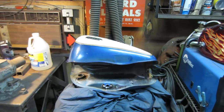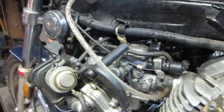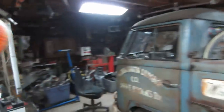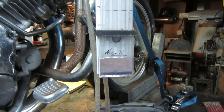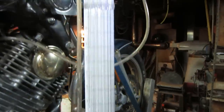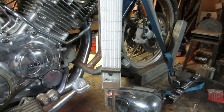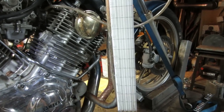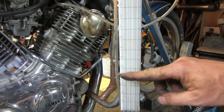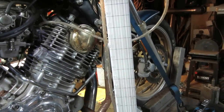I'm hooked up with a set of mercury gauges. Mercury is a very heavy metal which makes pulling a vacuum fairly accurate — as the vacuum draws up that tube it shows you how many inches of mercury you're pulling, and you're just trying to balance out the two cylinders. There are other things you can read too — if it's pulsing — but for the intended purpose right now we're looking to make sure that at idle both cylinders are pulling the same volume through them.